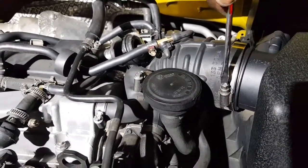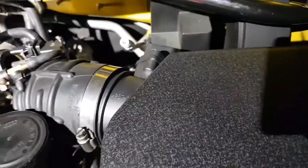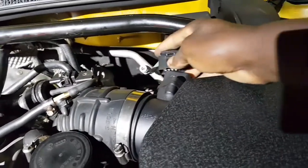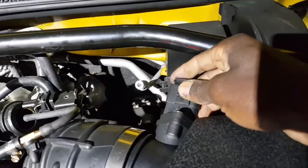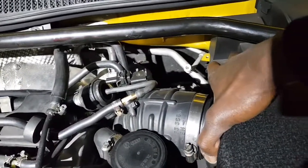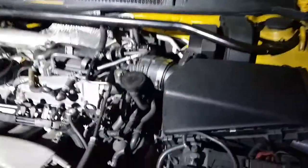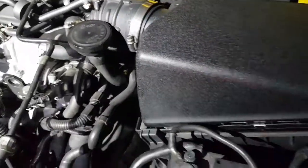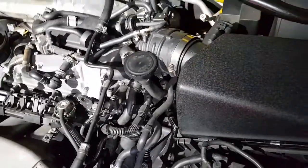Now, I wonder what actually caused it to come off like that. I'm thinking something flew through. I'm going to inspect that airflow sensor again to see if there's any debris that could have gone in there. It's very possible a piece of debris flew in. Oh, why does it not click on? Anyway, so that goes on like so. Debris has flown in and blown out the resistor, completely blew it off, or the resistor has just gone old and blown and come right off. It's just the strangest thing, the strangest thing I've ever seen. Oh well. At least we're solving something.